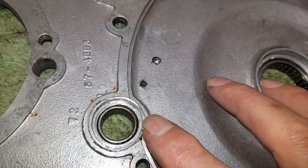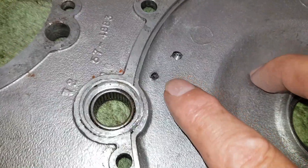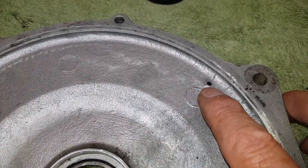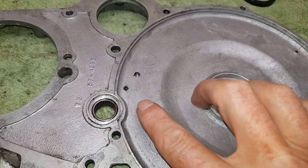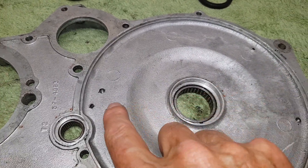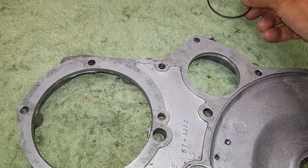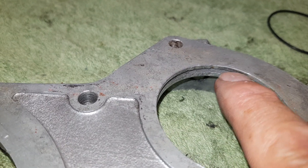You can note there's damage all over here - something's happened with the clutch and it's taken that edge in. These screws - certainly this one and I think this one over here - someone's put in screws that are too long, so they're coming out the back of the chain case into the clutch area. That's something to bear in mind that I'll mention in a minute.